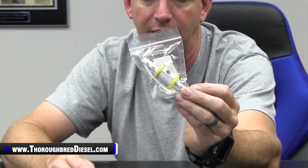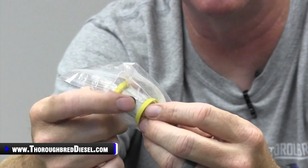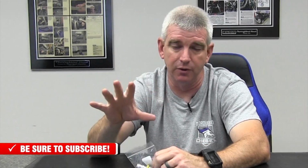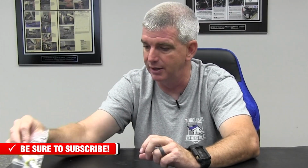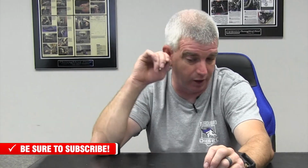Another one of the Quadzilla accessories that they offer is this inline 1/2 inch push-to-lock fitting that has a 1/8 by 27 MPT hole in it. That way your snubber and sensor can just screw right into this. You just cut your fuel line. You older guys that have got a smaller line, the 3/8 inch line, we offer an inline adapter for that as well.